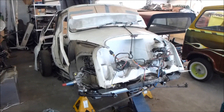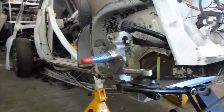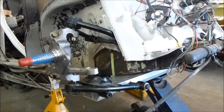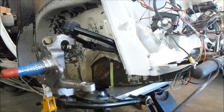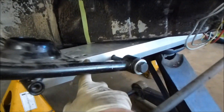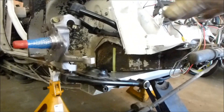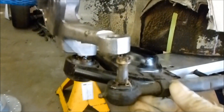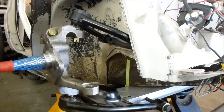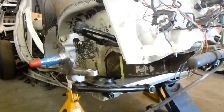The gremlin I've been fighting is the front suspension. I've got it mocked up, but today I decided I'm just going to do it — I've been thinking about it forever. I've got a modified Mustang 2 suspension. You can see the Mustang spindles and the Mustang 2 aftermarket tubular control arms. I made this trick cross member out of aluminum, with aluminum plates on the floorboards inside in a sandwich. I'm just crunching kingpin angles, Ackerman's theory, caster angles, and all that trying to make it all work.